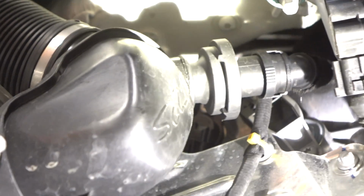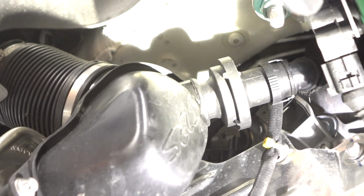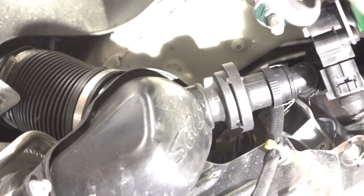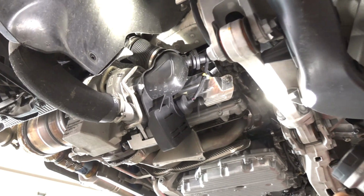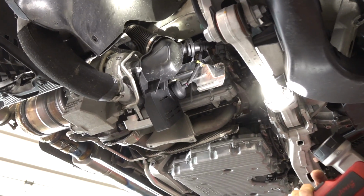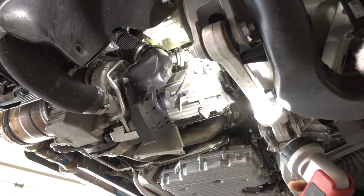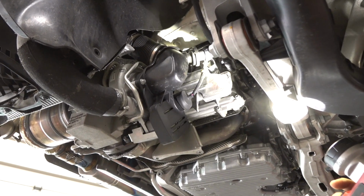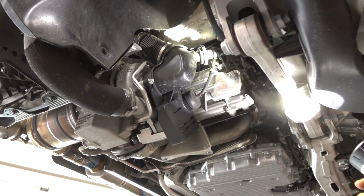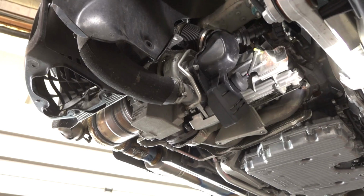And the inlet of the compressor section is a very important feature, because anytime you can optimize the inlet, you're improving the compressor efficiency. And the efficiency relates to density. So the more efficient the compressor, the more dense the mass air, and therefore the more power you get out of it. This car produces 700 horsepower, and it does it at the same pressure ratio as my 911 turbo that's rated at 560. So it's quite significant. It's mostly done in all these engineering feats.